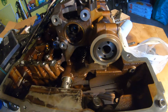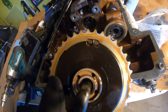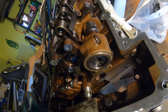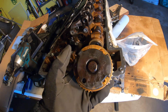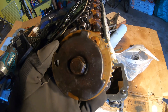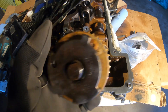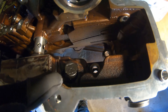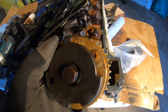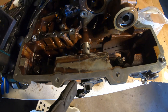So let's use this side as an example. This is our cam gear, and if you look in the back of the cam gear, this is spring loaded — there's a little spring in there, and the oil pressure goes into here to advance or retard the timing on this gear. There's a front part on the gear that picks up the signal; the sensor right here picks up the position of the camshaft, so it can advance or retard it as needed — all by using oil pressure by opening and closing this little solenoid.